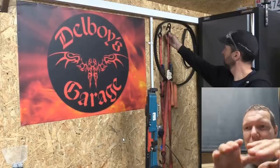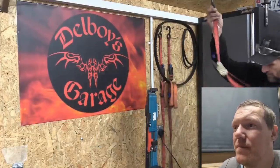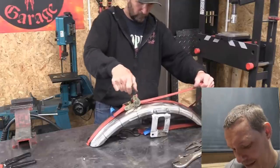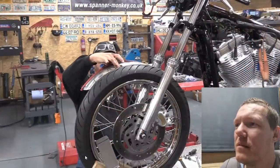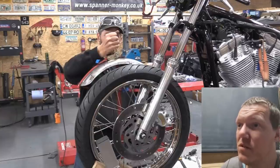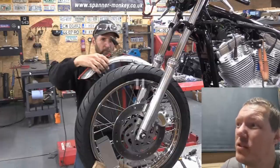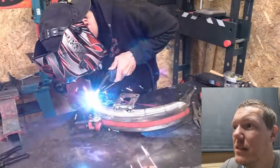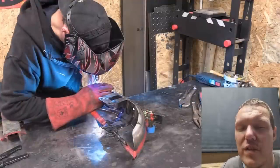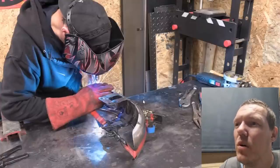When you fold it in like that it's going to flatten the top - when you pinch it, it's going to flatten the top. What you should have done is measure from here - it's called a chord, a line from one point to another that's basically tangential. You just touch there, touch there, measure the chord and you'd be all good - you could just draw it on your bench. This will or could work, although I should have done the middle as well. You can have a flat spot - this could work if you know what you're doing.